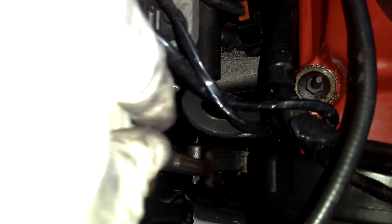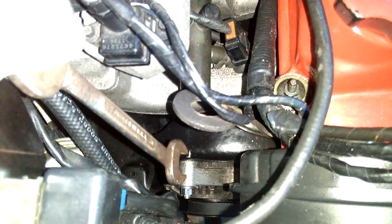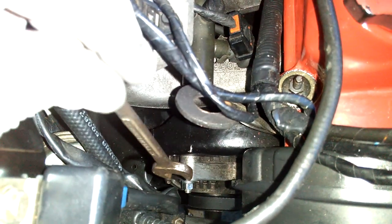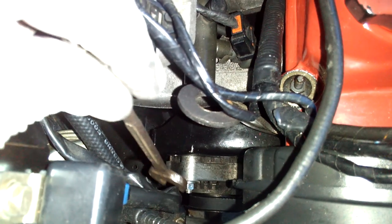This is how it works: the alternator loosens the belt by moving upward and forward on the black bracket. I make the white mark there so I know that this bolt right here aligns with the mark. If this bolt right here — the one with the groove — is not aligned with the white mark, something is off.